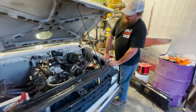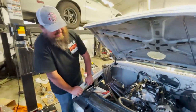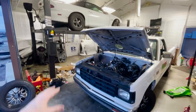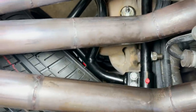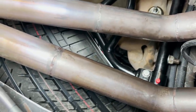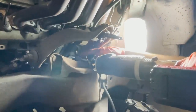Let's test out the whole suspension — this is stock, and then I put these coilovers at full lock all the way tight. Yeah, that's a huge difference. It's going to keep it way stiffer — at least it still has some movement but it won't be completely locked down. We're looking at clearance to the arm, so I grab some paper to check the gap. The bolt on the top of the shock is a little rusted and rounded off — seized on — so we're actually going to have to cut through it and get it off.